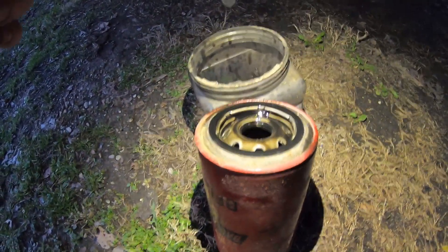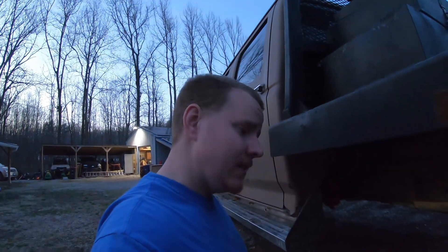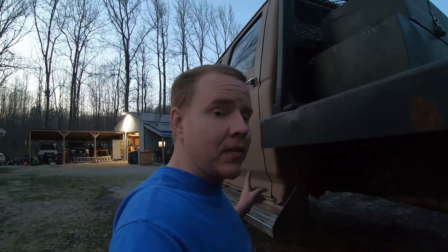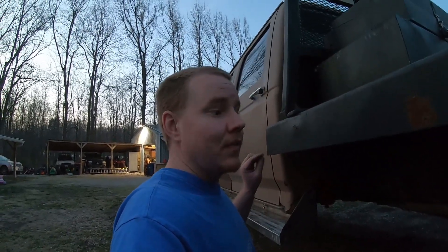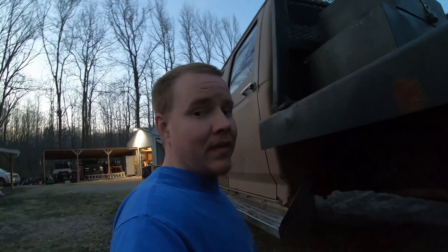That old filter has seen better days but it was still flowing. Now I'm just going to hop around the hood and get the air purged out of the system. The nice thing about running an extra filter right off of your oil tank — especially one with a lower micron rating than the main engine fuel filter — is that you typically won't have to worry about plugging the engine fuel filter from the oil tank, because this filter is going to catch anything that other filter would catch and then some before it ever gets there. I've never plugged an engine-side fuel filter.